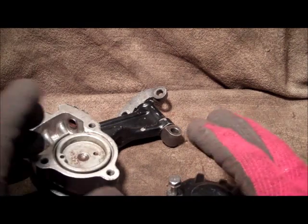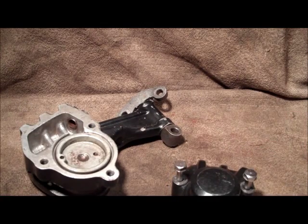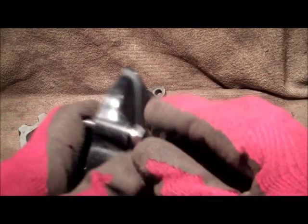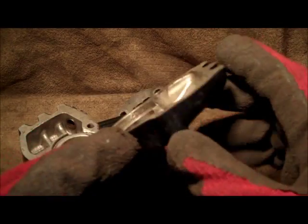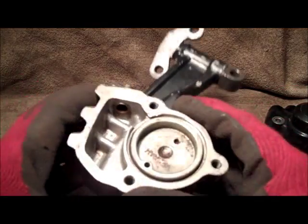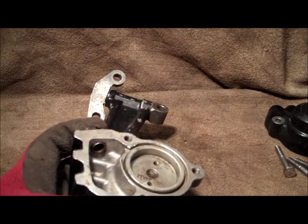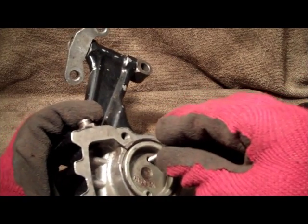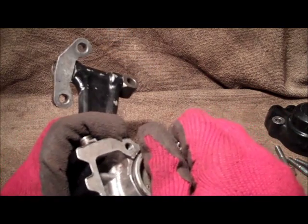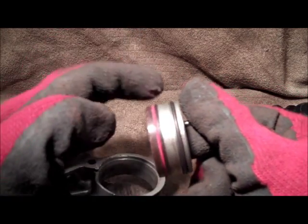Now we've taken off the caliper, we can have a look at its parts. The first thing to do is to get the brake pads out. Let's have a look at the cover plate - check for any dings or anything. It looks to be okay, and the spring is in good condition at the bottom. With this caliper it's got new pads in. One way to get the pads out is to get something in here and prise the pad out. There should be a little hole in here - in this case I think it's a 6mm bolt - and that should allow you to check and inspect the seal and the pad itself. Not very much wear on this - it's a fairly new pad.